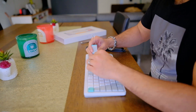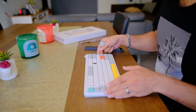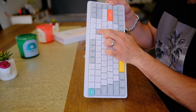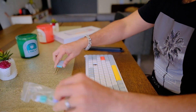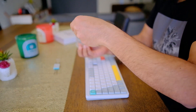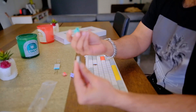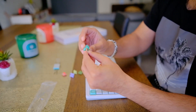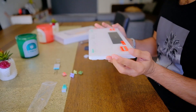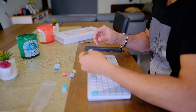In the world of mechanical keyboards there are three kinds of switches: linear, tactile, and clicky. Linear is for gaming and doesn't have a bump. Tactile does have a slight bump before the keystroke is registered. Clicky also has additional mechanisms that make an audible click. I went with brown switches, which are tactile, because I like a slight bump but I don't want something that is intentionally making noise. Along with the switches you can also find the wireless receiver, which you can attach to the cable.